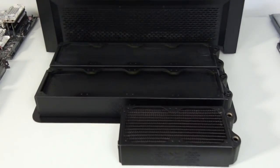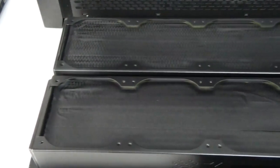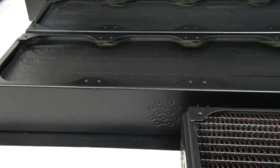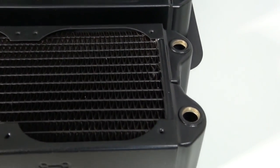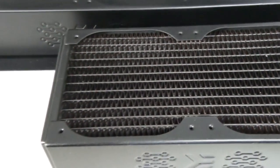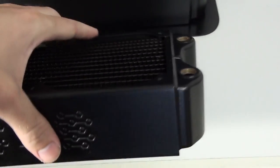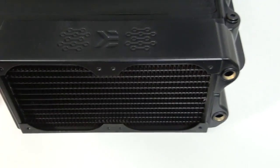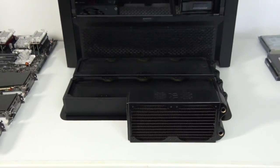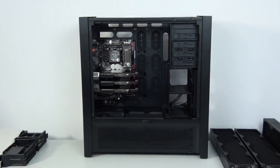Some of you might be wondering why I haven't installed the radiators yet. Common sense is to install large, heavy components at the beginning of the build, and installing radiators is usually one of the first things you do in a water-cooled build. The reason is I had to paint these radiators and I didn't want that to hold up the build. I paint a lot of my radiators because most have a very weak matte finish — usually powdery and already scratched and scuffed out of the box. I've painted these in a midnight black acrylic lacquer, and it's certainly a big improvement. That concludes this part of the build log — thanks for watching, please subscribe, like, and favorite if you want to see more.